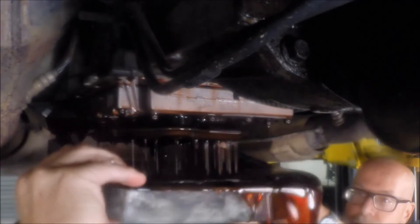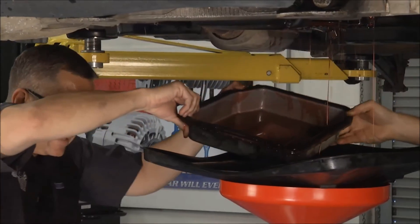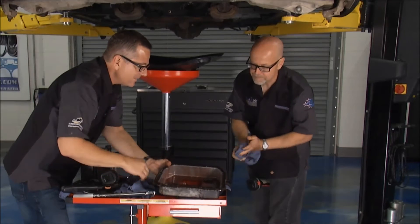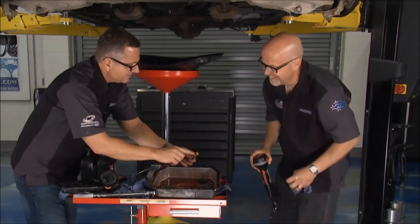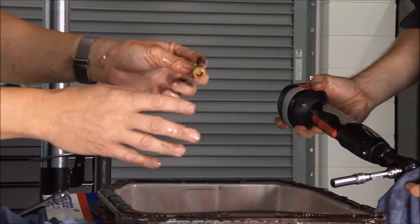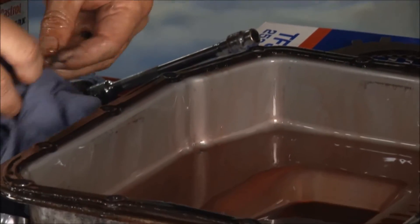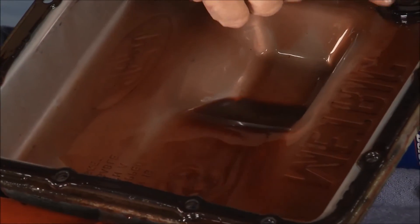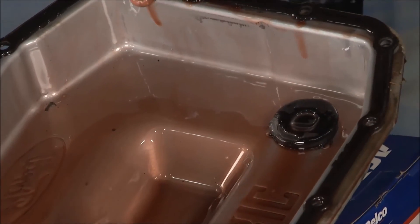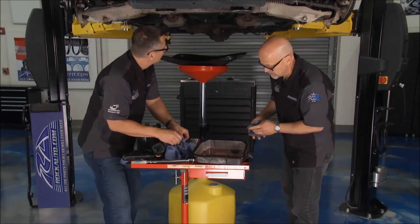It really is not in that bad of shape. This is pretty cool — you know what this tells me? That tells me it's never been apart before, because they actually put that plug in from the factory. We got 53,000 miles, it's never been serviced, ten years old. Good call. Now if you look inside of here, you've got a magnet right here — scrape some of that off with your finger. Wow. You see that? You know what that is? Bits of transmission. Yep, you clean that off. Now up in here we've got the filter located right here.